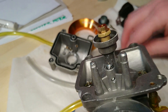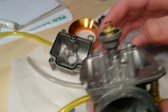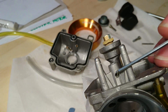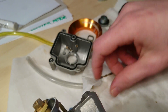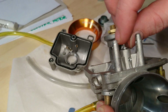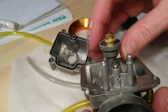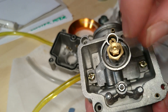So 3.2 millimeter drill — that's the maximum size you can use. The two small one millimeter holes that I've now replaced with a 3.2 millimeter hole were not in the center of this hole, but higher up in the casting. This meant that when the float was opening, they were still shrouded by the needle, so basically almost all the fuel flow had to escape between the bore and the needle.